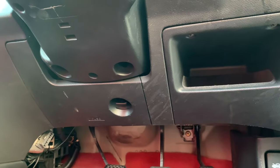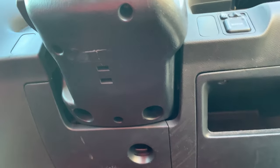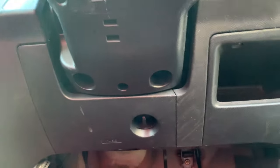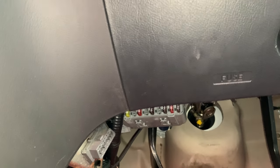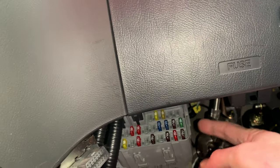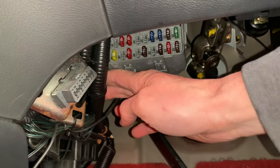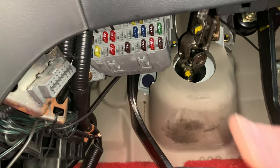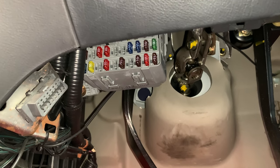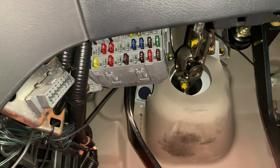From what I've seen online, the MICU module is right underneath the steering wheel, and that doesn't appear to be different between left-hand drive and right-hand drive cars. Mine's a right-hand drive. Flip these tabs and pop the fuse panel cover off — once that's removed you can actually see the unit right there. There's a 10mm bolt tucked behind some wiring cables, so it's probably easier to use a wrench instead of a socket. There's another bolt at the top, and the whole unit just slides out with those two bolts before you unplug and reconnect.